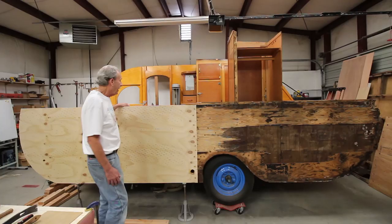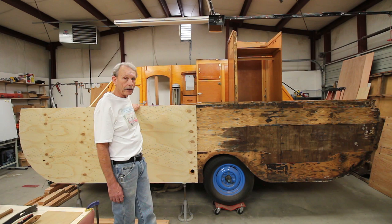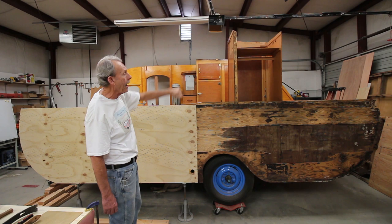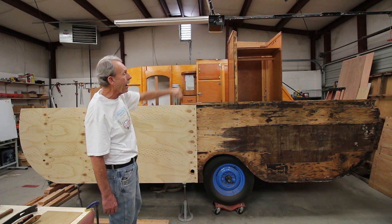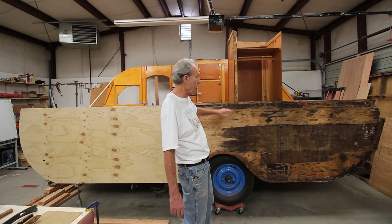I can't put it up until we have the framing ready for the joint here to hold it up, and it's going to need some other sticks here and there as braces to keep it held up until I get the wrap on. The wrap is the front, the top, and the rear — the ceiling, the rear wall, and the front wall — all one piece, basically called the wrap. Right now I've taken this piece down and I've got it all transposed and traced over to a piece of plywood. I'm getting ready to remove this old piece — you can see why they're being replaced. The whole reason for this project is this plywood just rotted away to practically nothing.